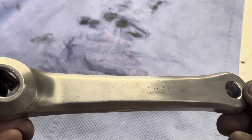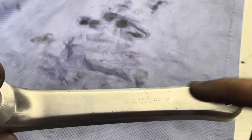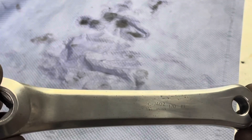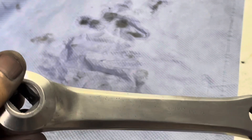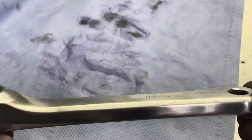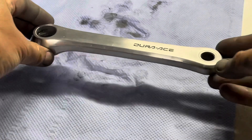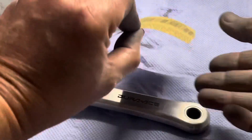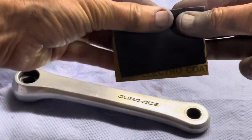Here I was moving through the different grades of paper — from 800 wet paper, making sure to get rid of all the scratches put in with the 600, then moving to 1000, then 1200, then 1500. That will be my final pass on wet paper. Of course there's nothing stopping you from going on to 2000 and 3000 wet paper as well.